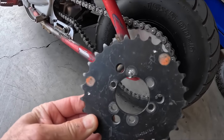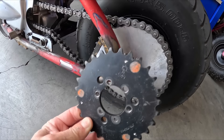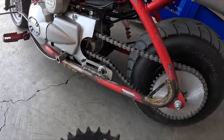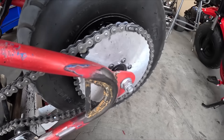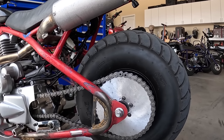Definitely a lot better with the 17 — got a lot more top speed out of it — but first gear is still useless, so it's definitely still too low. I have this 28-tooth sprocket and it's already drilled out for the hub that's on the bike. I'm going to throw that on there and that'll drop it another 12 teeth on the rear sprocket. We'll be going from a 40 to a 28 on the rear, and we went from a 13 to a 17 on the front. That should make a big difference. I'll go ahead and swap this out and pop the chain back off. I think a 28 will definitely help it out.